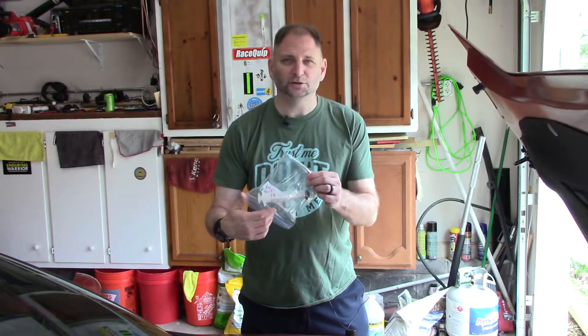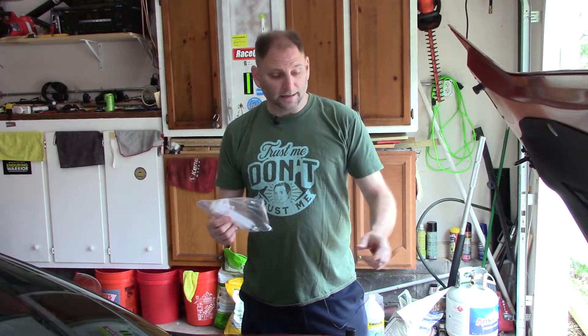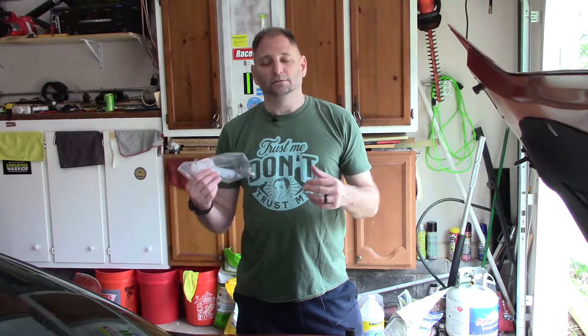The way I'm going to flush it out is I've got a little syringe here with a tube, and I extract the fluid out of the top. Now you could disconnect the lines and do all kinds of stuff. I do it this way because I'm lazy and it's simple, and while you don't get all the fluid out, if you do this enough — a couple times a year, more depending on your driving conditions — it gets your fluid cleaned up.